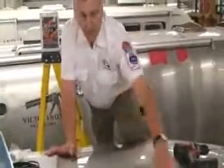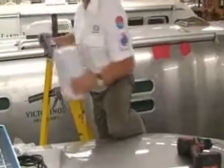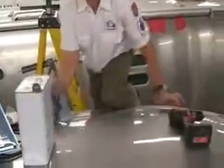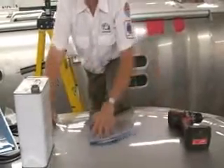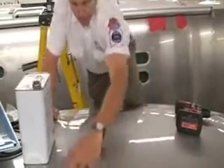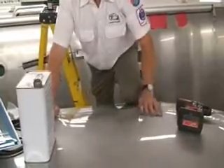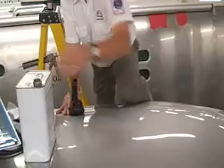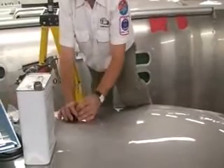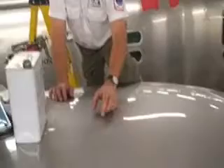I'm going to set this off to the side and start with a clean surface — I've already got my holes marked. I want to take some denatured alcohol and wipe down the surface up here because we're going to be using some sealer and I want it to stick. Denatured alcohol cleans the surface and ensures good adhesion, and it dries very quickly. I've got a number 40 drill bit — I'm going to be screwing with a number 8 stainless steel screw with a rubber washer on it.